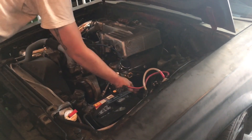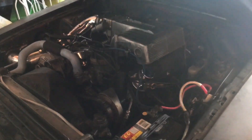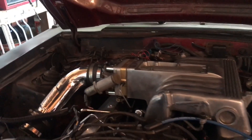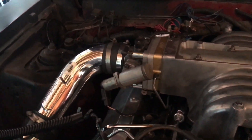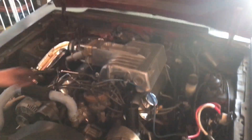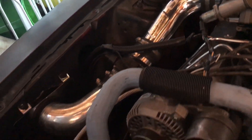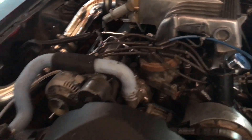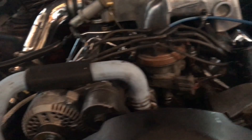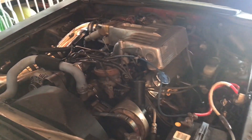So why don't you tell everybody a little bit about this motor? I got GT40 three bar heads and a Ford Anderson N41 cam. It's got Scorpion 1.6 roller rockers, a cold air intake, an Explorer intake manifold. It's got nitrous — I'm not sure what shot I plan on using. I did the 3G alternator upgrade, got the AC delete, aftermarket valve covers, and a half inch intake spacer.